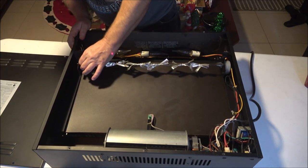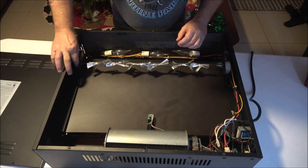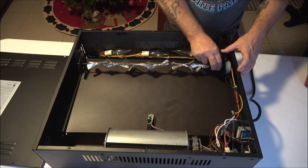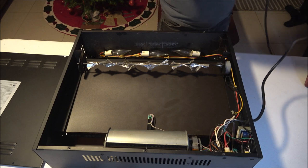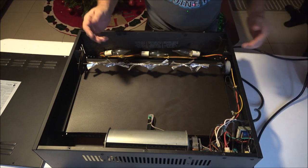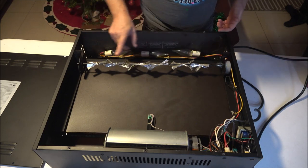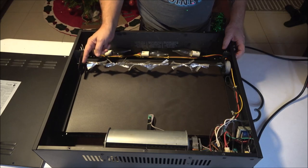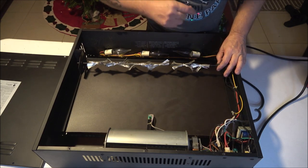So we're going to put it up here and turn it on. There's a grommet in here - they wear out and make a lot of racket. It could be the motor making the noise, but let me get it plugged in and we'll turn this thing on. I don't need to turn the heater on because it's working fine. We'll see if it's the motor or if it's right here - usually it's right here. But let's just plug it in and find out for sure.